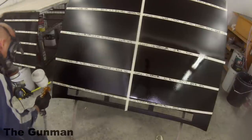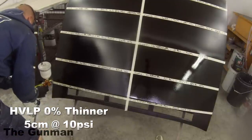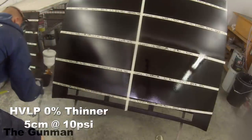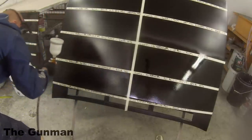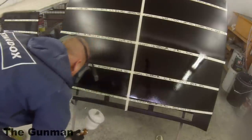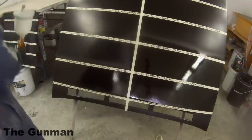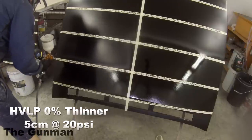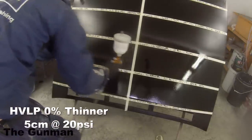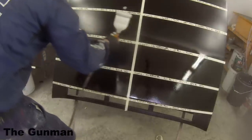For this side of the bonnet, every spray test on the left-hand side is going to be with an HVLP air cap. It is a different style of painting — when painting HVLP you really need to go just a little bit closer. I found optimal for HVLP is five centimeter distance, which is very close. The main reason is so it doesn't atomize too thickly, because there's a lot of air volume coming out and that can tend to atomize in a very thick way compared to conventional and LVLP spray guns.